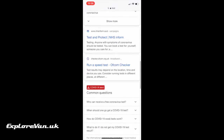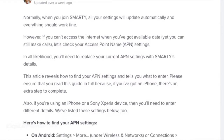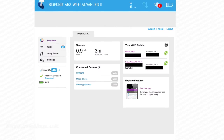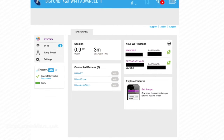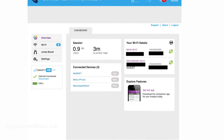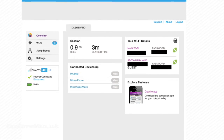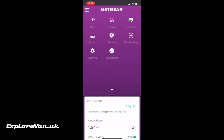If it doesn't work, you may need to set up the APN for your network — you can get the details of your APN from your SIM provider. To set this up you'll need access to the MiFi or router settings. You can access this through a computer browser and the details will be in the instructions for your MiFi, but most MiFis also have an app you can download to your phone, which is the easier way.